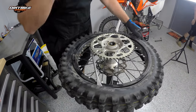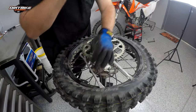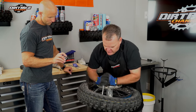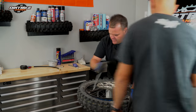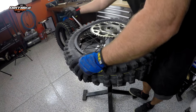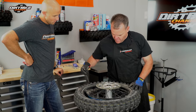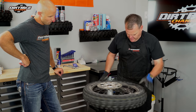I pick up on the tire with my left hand and get the spoon under the sprocket, then work my way around just like I did the other side. I keep my body against the tire to brace it. Now I can be down to one spoon, pushing with my body against the tire, and you can see the rim lock and valve stem are clear.